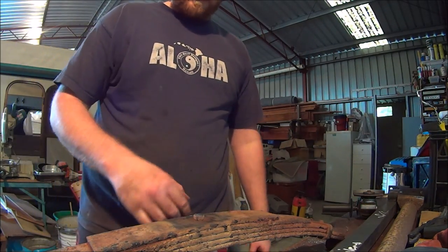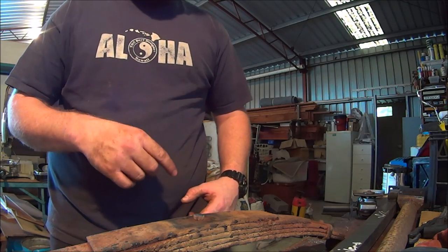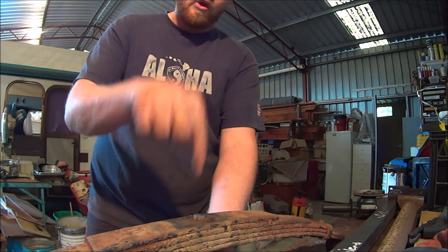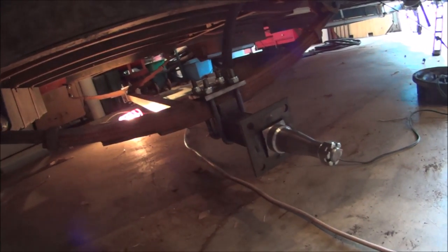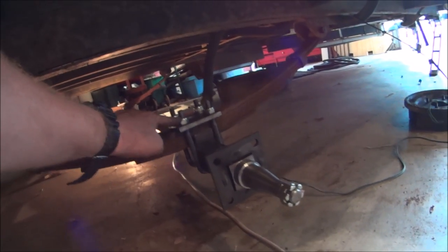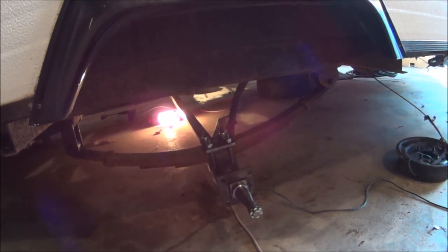All I'm doing here is taking off the locator bolt that holds the pack together, because I'm inverting the springs and that little tail of the bolt sticking out was going to be in the way. So I'm just taking the head off it rather than unbolting the old seized pin and flipping it around. The beauty of underslinging the axle like this is that the thread from the U-bolts ends up facing upwards, not downwards. Before, they were facing down — the risk being that off-road, if you smash into a rock and mushroom those heads or deform the thread, it makes it very hard to get those bolts off roadside. So it's a bit more protection for off-road going this way, with the added bonus of a lot more ground clearance.